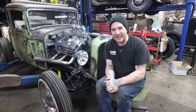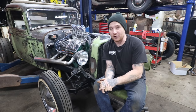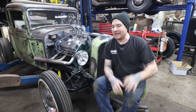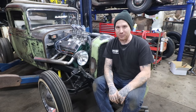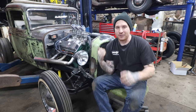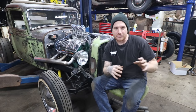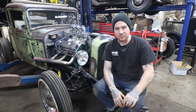If you wanted to build an engine that was really fast and could beat everybody in your town and was very fast at the drag strip, you would start with a 371 or 394. These things made a ton of power and a ton of torque right out of the box. You could take a factory J2 engine, drop it in a '32 Ford, and you were king of the hill. And when you start hopping these things up, it just substantially started going up from there — that's when things really started to break. The parts that people were swapping in, using a factory flathead-style trans and rear, when you got into these engines, that's when you really started breaking things because they made so much more power than a flathead. The 303 early engines, they made like a hopped-up flathead kind of power, so those weren't as bad with breaking things. But when you got into this larger cubic inch, all those drivetrain areas were when you really started to break things.